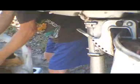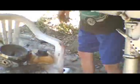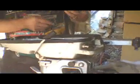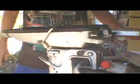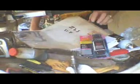And other things you want to do: I've taken the carburetor apart and it was dirty. Check your jets, take the float bowl off, and use carburetor cleaner to blow through the passages. That's very important to put back together. Check your gas tank for leaks. I had some leaks, but I got some plastic welder that I used, and this seems to work really well to repair any cracks. Because then I bought a new, good used rope pull on eBay.